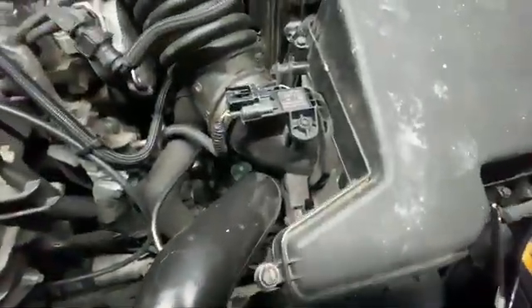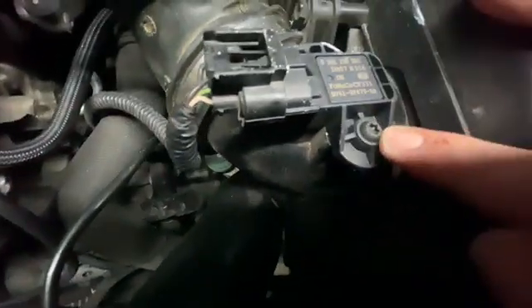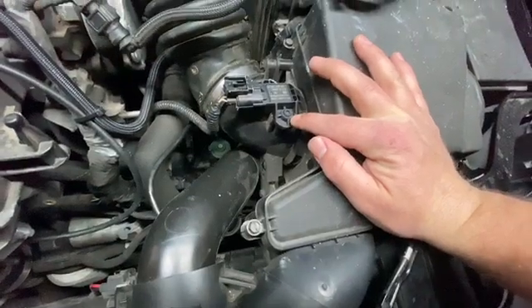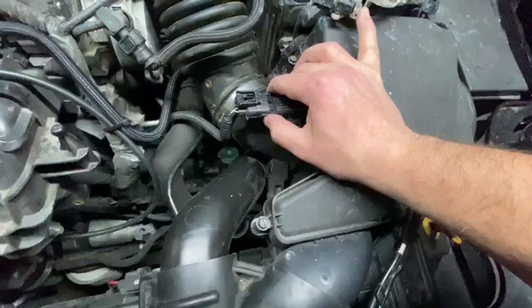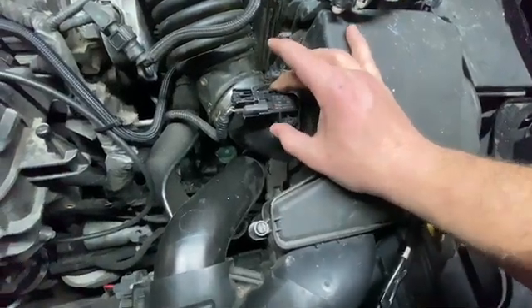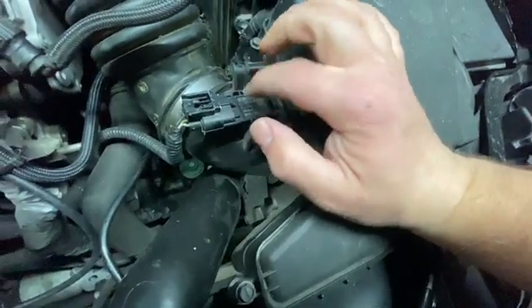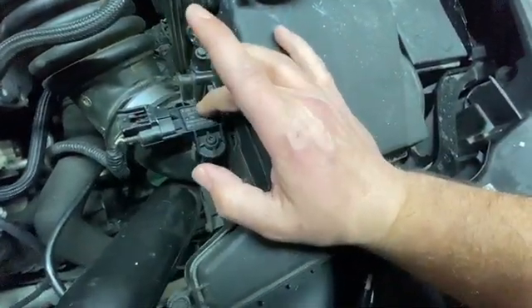There are three of them. I don't know what all the differences are. I just replaced this one, and this screw right here was $10 from Ford. You cannot find these — I went to Ace Hardware, Menards, I tried to find a screw that was the right size and had some employees help. I couldn't find any that threads in right and actually keeps this secure. If this is loose, you'll start throwing engine codes, so a lot of times this will be your culprit. This connection might be loose too, but typically this will be a little bit loose.